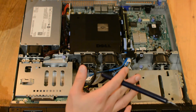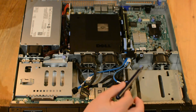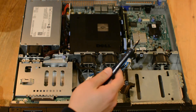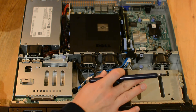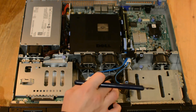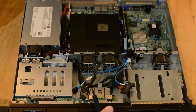One thing I'll probably upgrade in the future is adding an SSD — I can mount it right here with some double-sided tape, connect it to the board, and split one of the SATA connections with a splitter. That can be used for image backup, dump files, or report files from the OS. Otherwise, you can see the two internal USB headers — one here and one here — and I'll put my USB thumb drive in there initially to install TrueNAS Core.